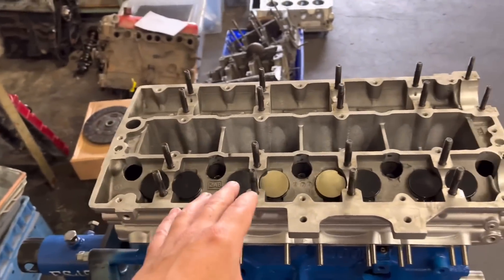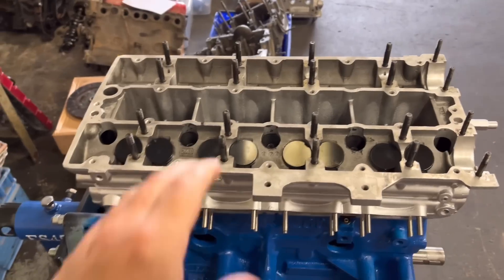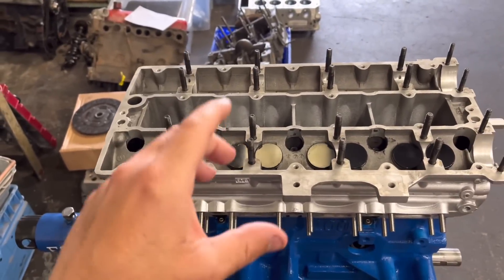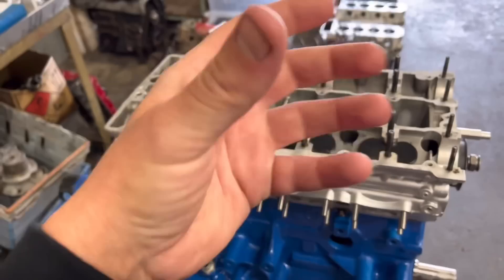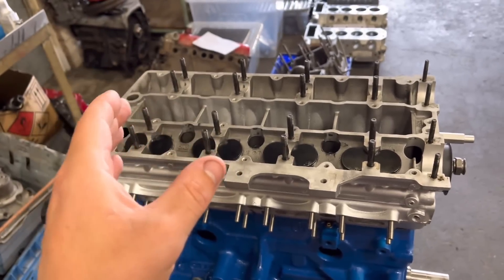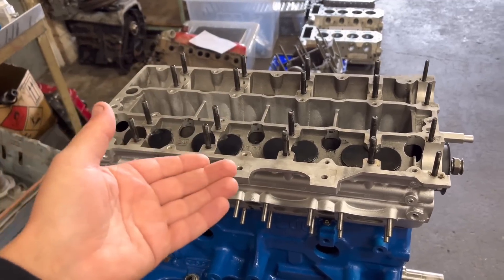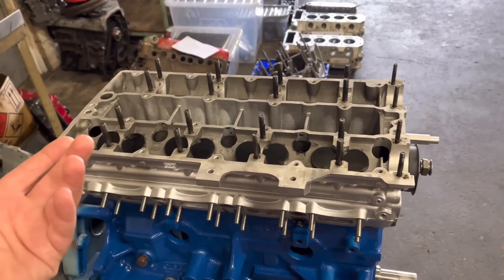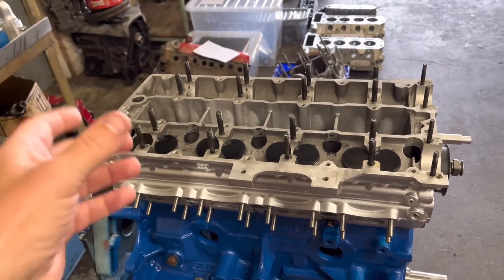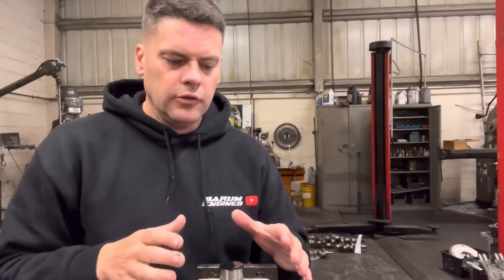Well, they're an original copy basically. They've got the coating on the top so they're absolutely bulletproof - they've got the twin chamber barrel inside. What I tend to do first is: when they come from new in the factory they come with a fluid in them which jacks them out. It's like a preservative fluid really. But what I tend to do is squeeze that out - two reasons: one is to get rid of that fluid, and two is to make sure that they're nice and squidgy so when we fire it up we're not going to have any valves that are jacked open and the pistons hit the valves. So I always do that with hydraulics. We have got a jig to blow them apart but to be honest if you're careful I just tend to squeeze them out.